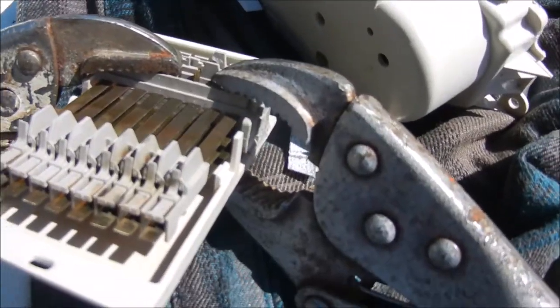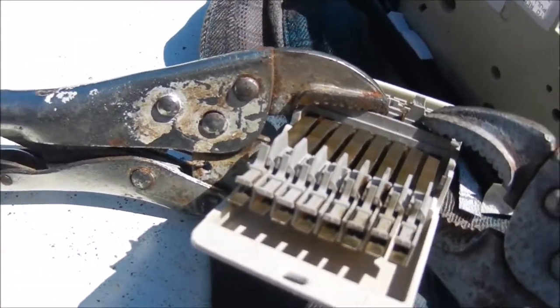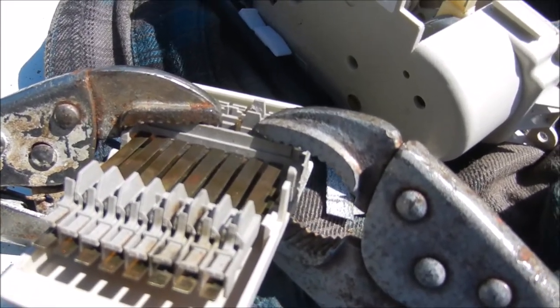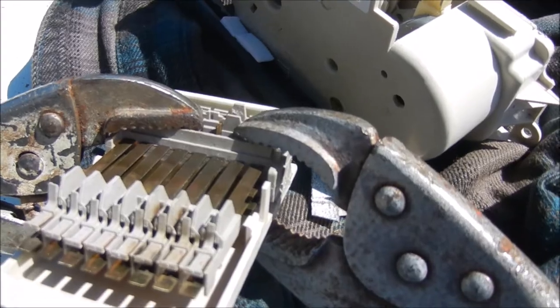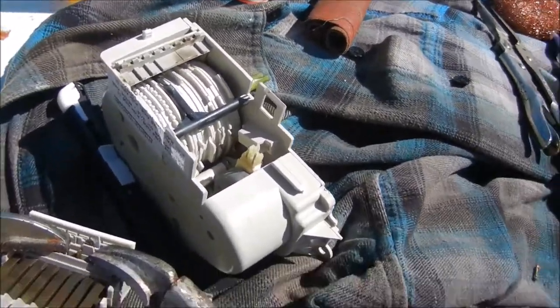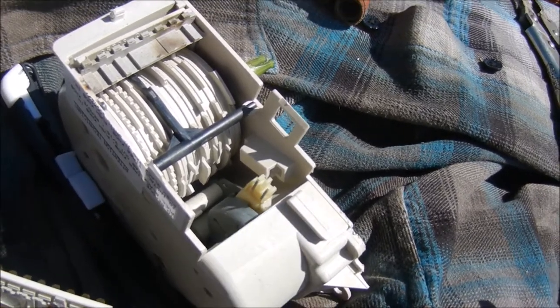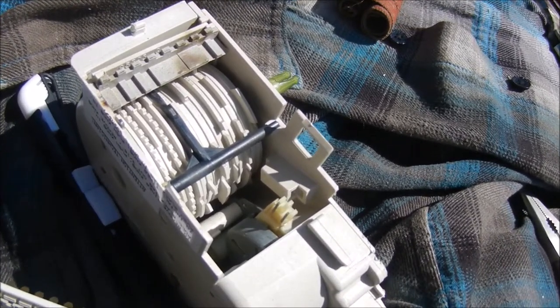What I'll do is take it apart, clean these points with a little bit of sandpaper or fine emery paper, then close the tolerances — basically put a little pressure on it, just tweak it back a little bit, and normally that gets them going pretty good. There's a rivet that holds the points onto the back of the timer, and that has to be drilled out in order to clean the points thoroughly and put new surfaces on, if the tolerances permit.